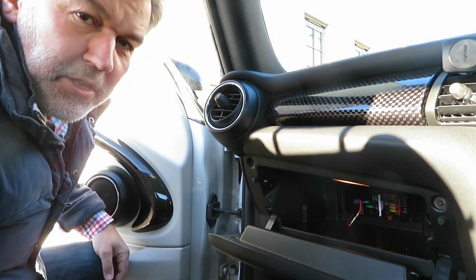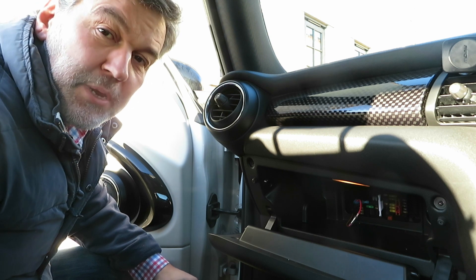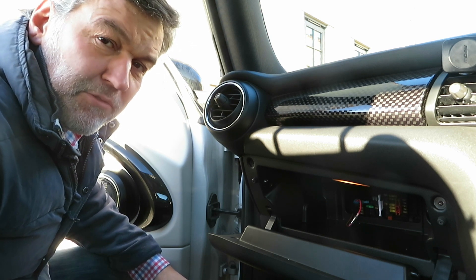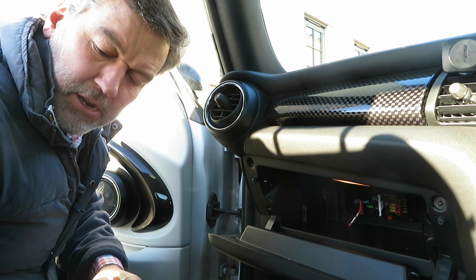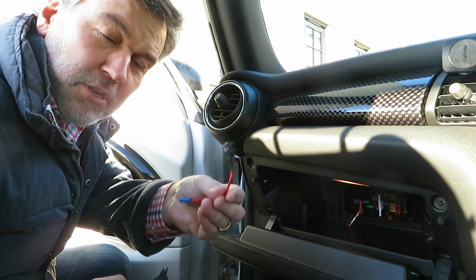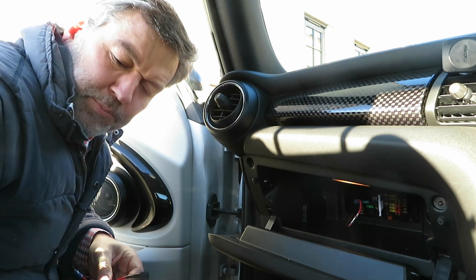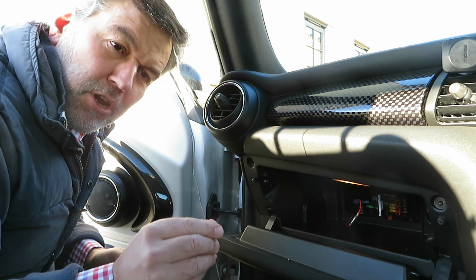Morning. I thought I'd share with you this morning how to install the hardwire cable into a Mini F56. I'd seen one or two things on YouTube but everything seemed overly complicated. This is basically straightforward with a hardwire kit, a piggyback connector — just make sure you get the right one. There are two options out there and that was the one I got wrong first. You'll notice the connectors are wrong on one of them; this is the right one for this Mini BMW. And some basic trim tools and a long coat wire — I'll show you in a moment.